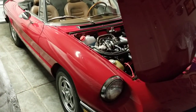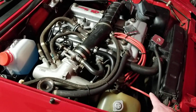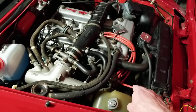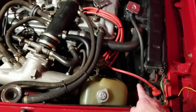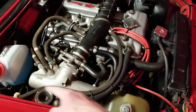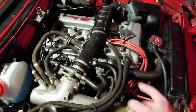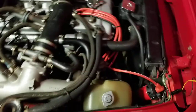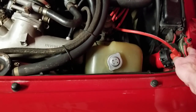That's it for the update — I'll follow up as soon as I've done a little bit more. Just a quick note: if you're interested in these wires, I love MagnaCore wires. I've run them on everything I've owned — the Alfa, the GTV6, Land Rovers — always had good luck with them. They come with two coil wires so depending on where your coil is mounted, you have a wire supplied for that location. The coil wire coming up front is 90-degree, which is good so you don't have any issues with it rubbing on the paint on your hood.